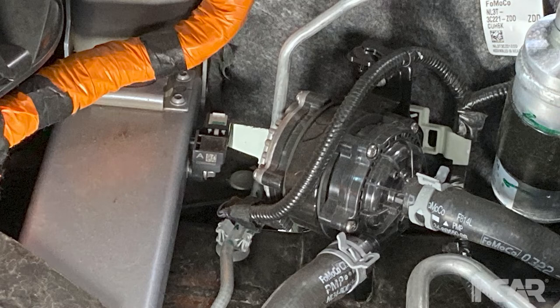Yeah, the electric water pumps are used there so they can spool them up at any time. Even when that truck is just sitting there, if it gets too hot or too cold, the systems can fire up and take care of the battery to maintain its temperature where it needs to be. So that's an interesting attribute of the electrics, and this one included, the noises it makes when it's sitting there. In many cases, those noises are normal. It's not uncommon for it to fire up and you hear gurgling, fluids moving and stuff like that, because of the nature of these systems, where they can fire up and make sure that the vehicle's comfortable at all times.